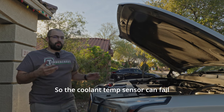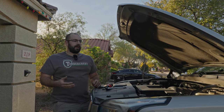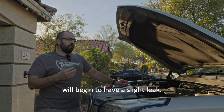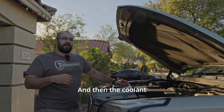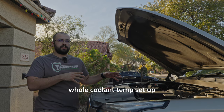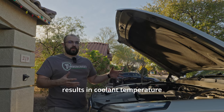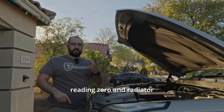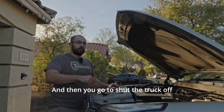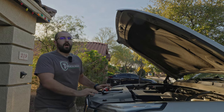I started looking deeper and it sounds like it's actually a thermostat housing issue. The coolant temp sensor can fail, but also the housing itself can fail. The thermostat housing will begin to have a slight internal leak, and then the coolant temp sensor can't figure out what's going on, which puts the whole coolant temp setup into a limp mode. That limp mode results in coolant temperature reading zero, radiator fans running all the time, and when you shut the truck off the radiator fans keep running for like five minutes.